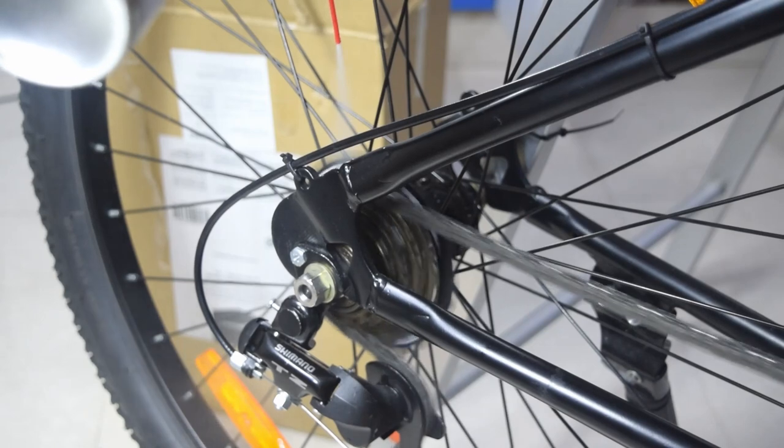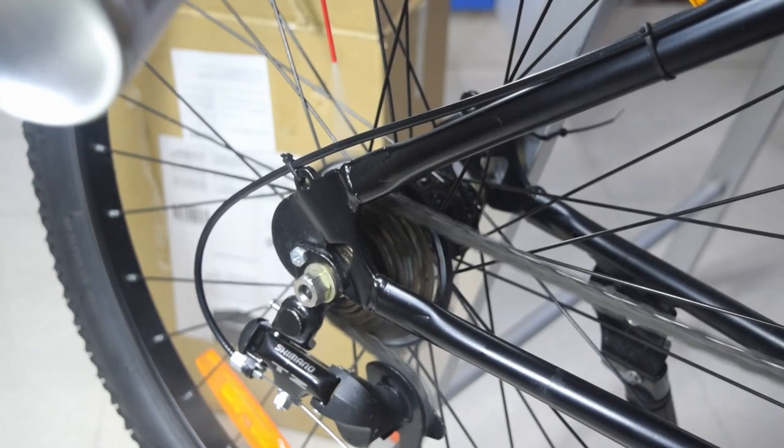Next, I adjusted the brakes to work with an off-center wheel. I had to add extra spacers on one of the sides and remove spacers from the other side, and got it to work with an off-center wheel, which also took quite a while but worked out somehow. At this point, I lubricated the whole new drivetrain with some silicone lubricant I had lying around, cleaned all the brakes and the chain, and I was pretty much done.